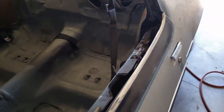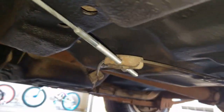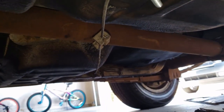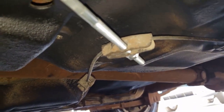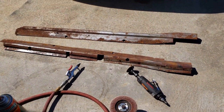Let me show you guys the parking brake cable in case anybody ever has to do one. That one goes to the passenger side and connects in with this little turnbuckle right there. Then this cable running through this piece goes to the driver's side drum, comes up, loops through, and connects with that rod and then goes up.